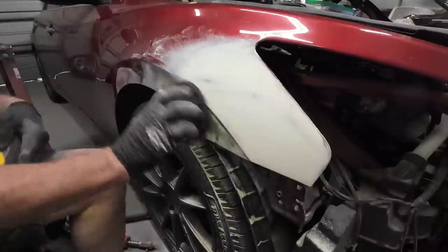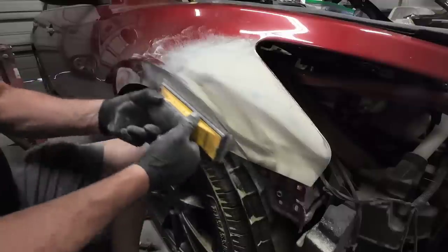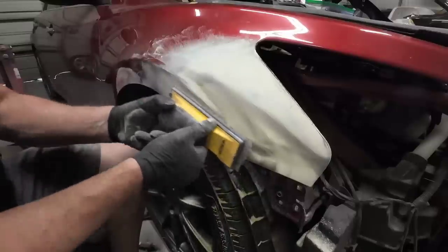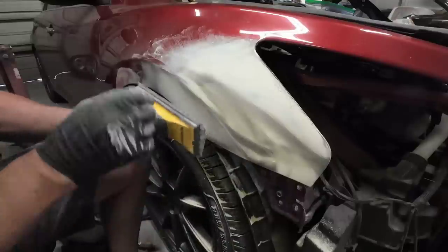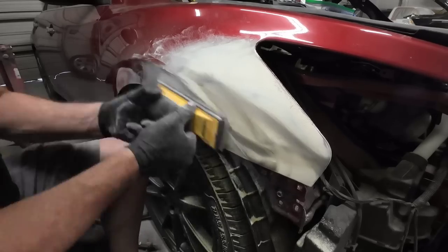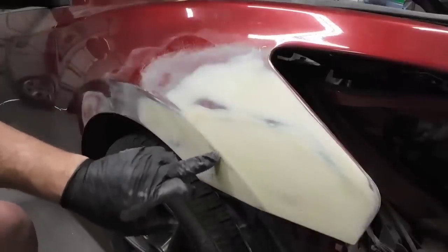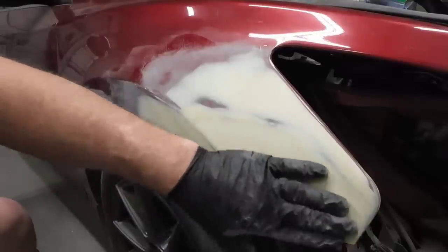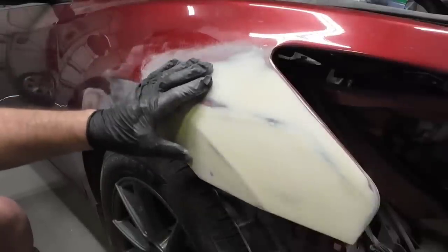Some guide coat on here — this will cover a larger surface area and allow us to see our low areas. I can tell it's a little high right in through here, and there's a little lower there so we want to block down to that if we can. Now all we need — we've got a couple little low areas and a couple little pin holes here — we'll fill those with just one coat of icing and this will be ready to go, then we'll sand that with 180 grit sandpaper.